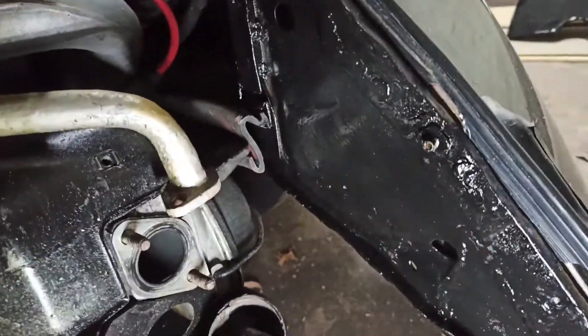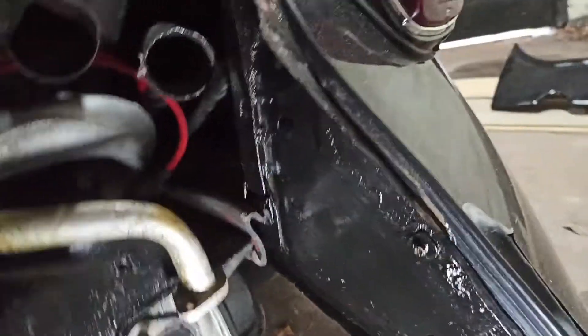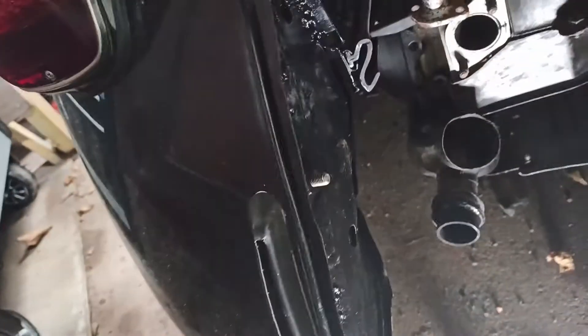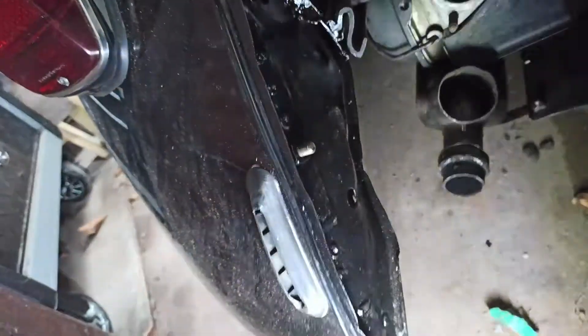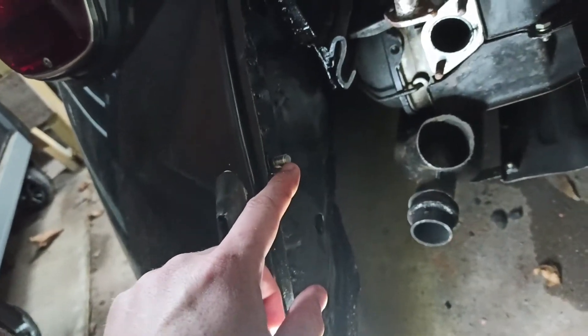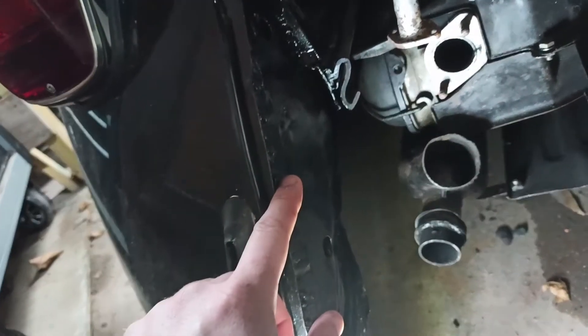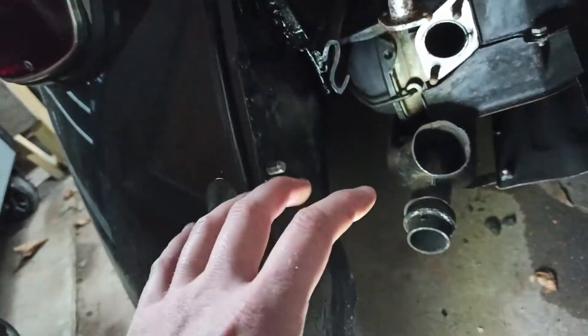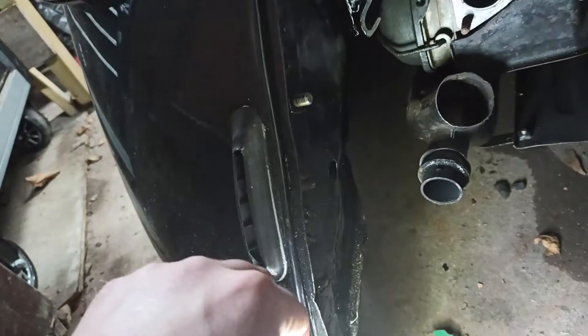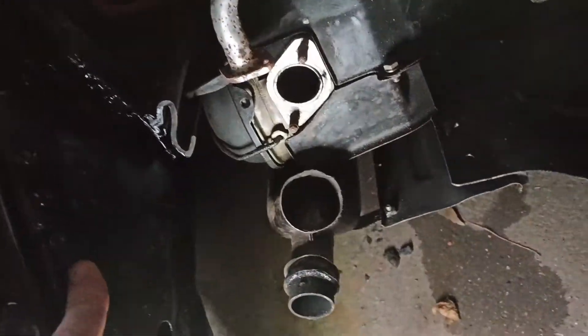Next I need to do the rest of the bodywork — I'm going to be taking off the wings eventually and replacing the wing bolts. I have replaced some wing bolts over here. I found some titanium bolts on eBay, and the reason I've gone with titanium is so they stop rusting, because the stainless ones I've got have only been there a few years and they've already started rusting — I'm guessing the stainless steel coating comes off. So I've gone with titanium for now.